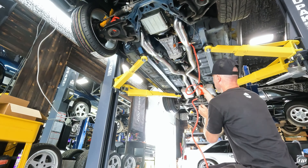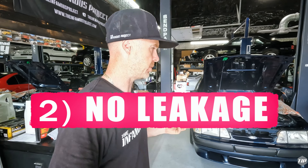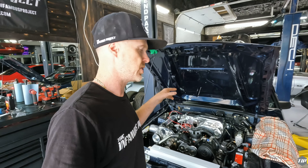No leaks — I had it up in the air and everything is good. I haven't put voltage to the fuel pump yet, so I need to double-check all the fittings: number one, fuel is pumping; number two, no leaks. I also plumbed the last of the vacuum lines and just finished messing with the MAP sensor, which I'll show you a bit of footage on, because it's a different style sensor than what came with the kit so I had to repin it.